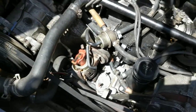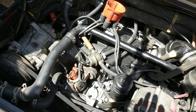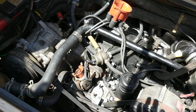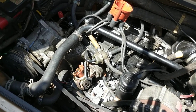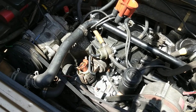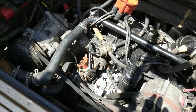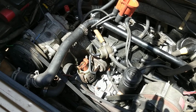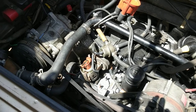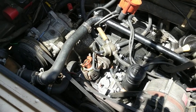Put your cap back on, hook up the vacuum lines, and it's ready to go. That's basically how to install a distributor on an air-cooled Vanagon or 1.9 Waterboxer. On a 2.1 it's very similar except you don't have to mess with the vacuum advance unit, so it's actually even easier. If you like this video give us a thumbs up, subscribe, and visit us on Friday at five o'clock for our live stream. Hope you get more miles with your van!